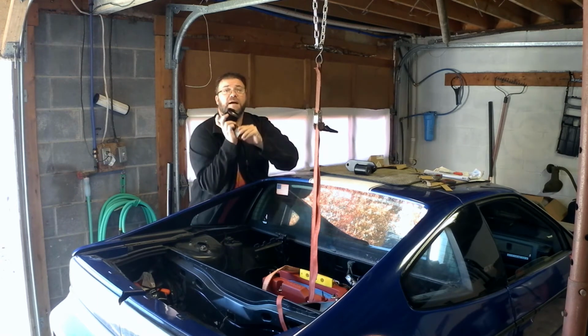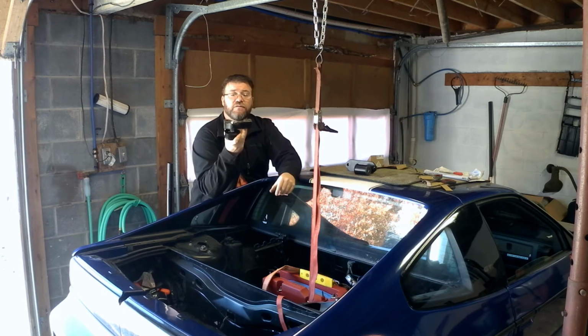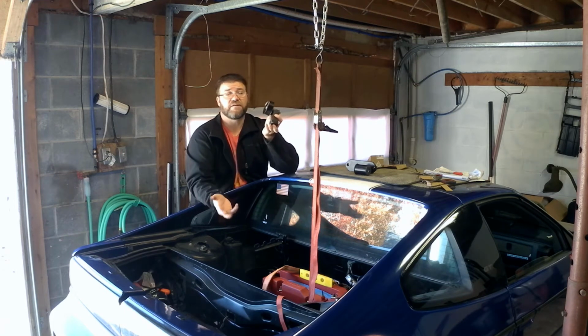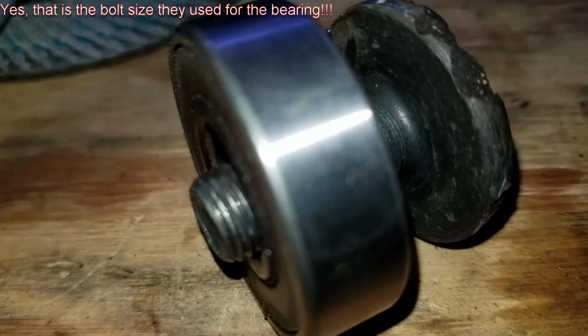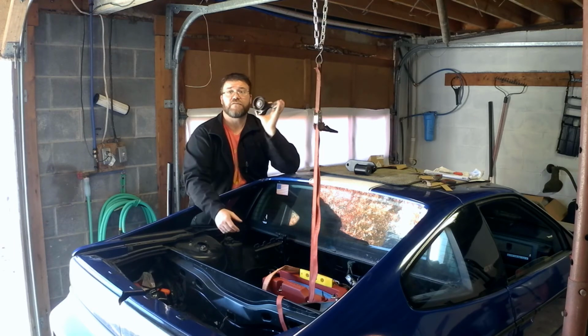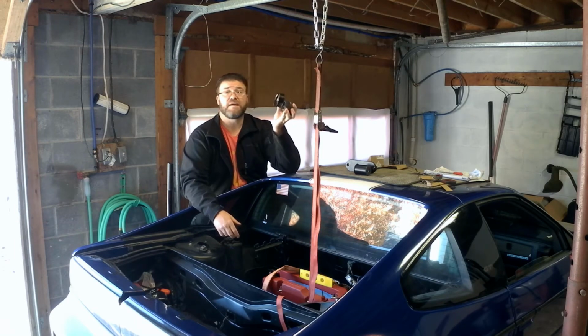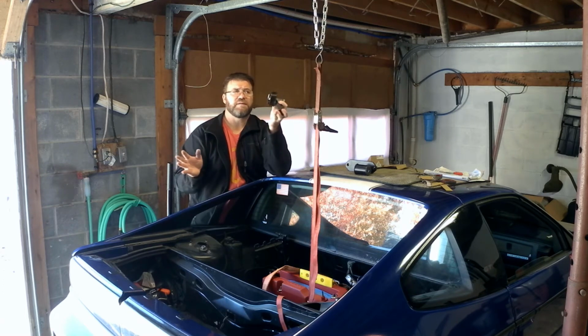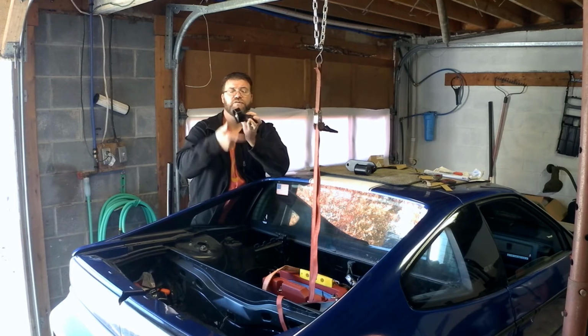Power steering delete. Made this myself. Took about 30 minutes. Stuff I had laying around. This pulley was left over from the K28 where somebody tried to make this, but it was all crooked, as you've seen in previous episodes. So yeah, belt sander to the rescue, flattened it out, made it square, cut the old one off. I mean, it was booger welded like you wouldn't believe. Now it's nice and square, rolls freely, winning.